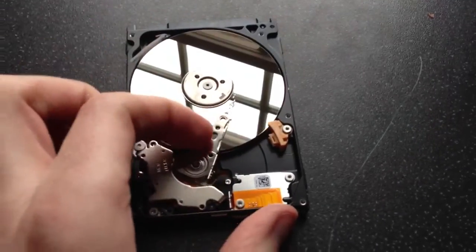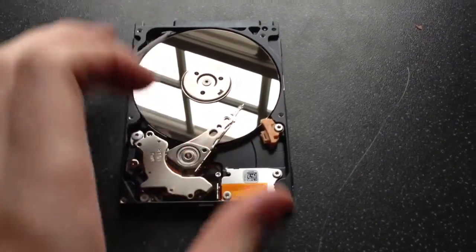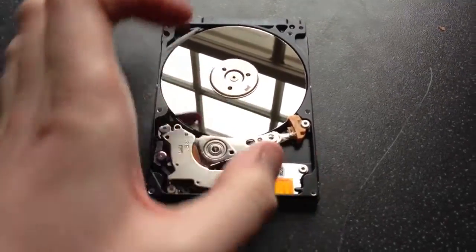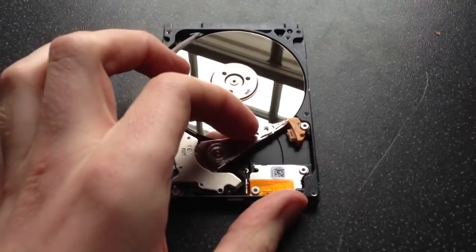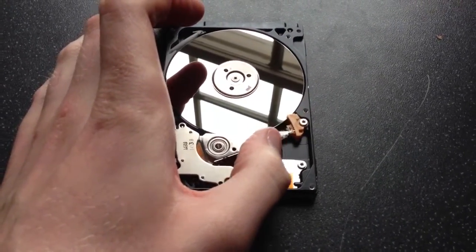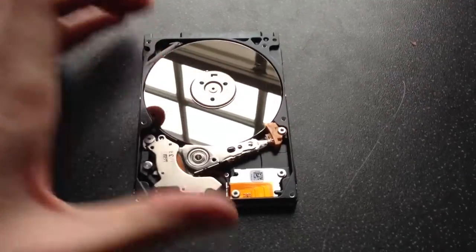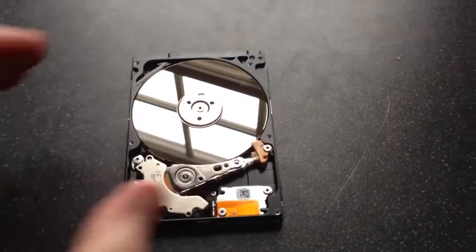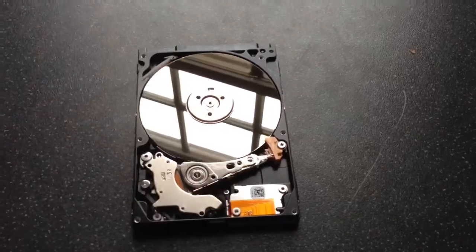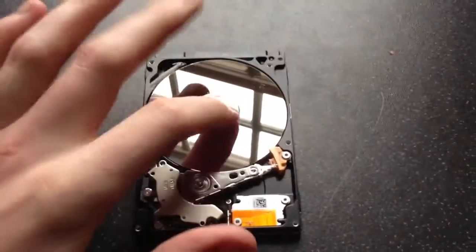This arm is usually sprung — I believe this one still is — but due to it being switched off, there's no pressure to hold the heads above the discs. The drive's already broken, so there's no data to retrieve. As you can see, if I just lift it, it very quickly returns back to its original position. That's so that if power is lost to the drive, it will automatically park itself. Say you're using a laptop and the battery goes dead — the head for the hard drive ends up in a safe position, so that as the hard drive gets moved, it's not going to get knocked and damage the actual discs themselves.